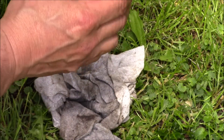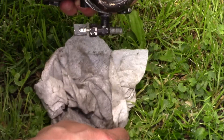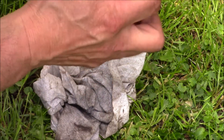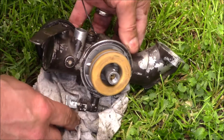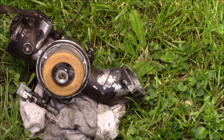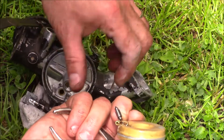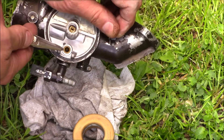There's one bolt on the bottom here. This one happens to have an adjustable jet on it. Take that bolt off, and then there is one pin here you want to take out. Make sure that your float doesn't have anything in it. Take this pin out, and we need a needle and seat for this — or you could purchase a new carburetor, but they're like forty dollars. The seat is down inside here and we'll need to replace that.